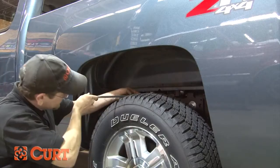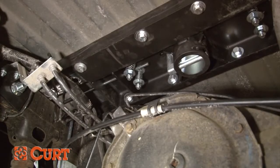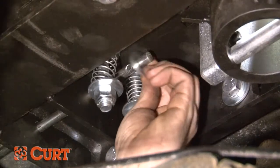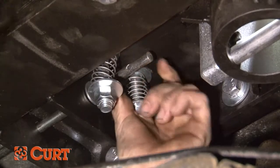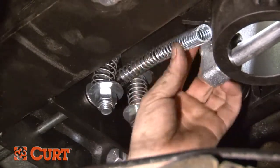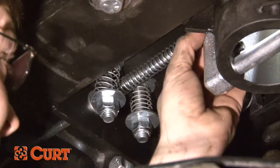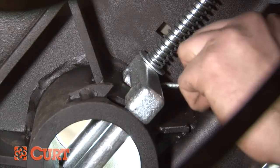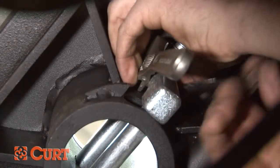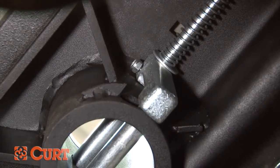Once the notch is cut, insert the handle rod from outside the vehicle through the hole in the 60615 end plate and through the rod guide as shown. Slide the compression spring between 2 washers over the handle rod before inserting the rod into the locking pin. Now that it's in place, secure the rod with the bolt and nylock nut. To ensure proper pull length of the locking pin, you may need to use additional 3/8 washers.